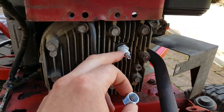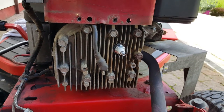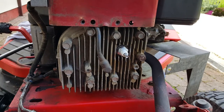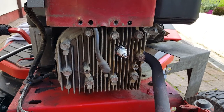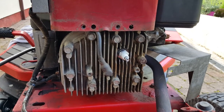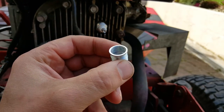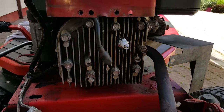When you have the spark plug threaded in, give it a very, very light tighten and that'll get you going. Normally you'd have to go get a new head if you split the threads, so this threading kit is a fix for a while. I'll probably have to replace the head eventually, but it gets the grass cut as they say. You can get that kit readily available — there are also black inserts you can get, maybe they're stronger than this light alloy. Thanks very much for watching.